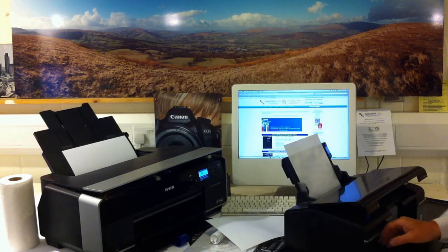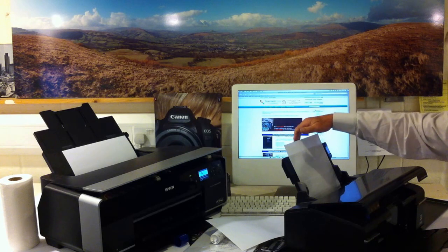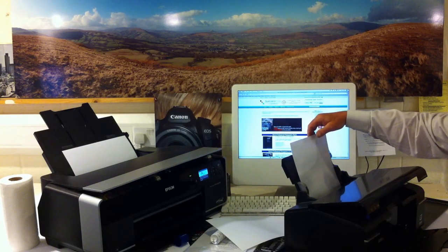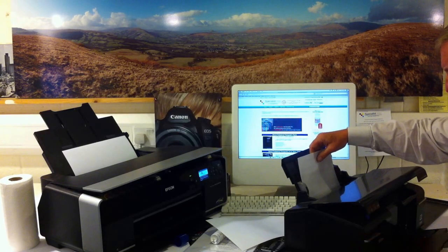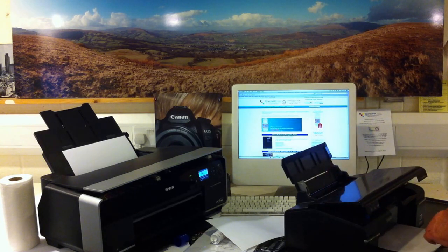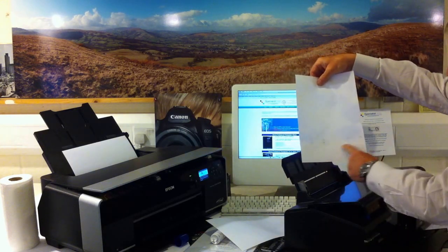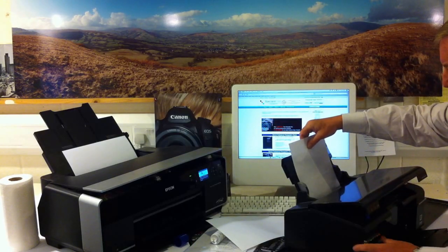You press your form feed, and when it pulls through you simply hold up the cleaning sheet as it feeds through. We are waiting for the printer to go through its motions — and here we go, we just push the button. There we go, holding it up as it goes through. We take it through and already you can see the muck coming off the rollers. We turn the cleaning sheet round and feed it through again.